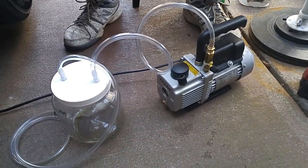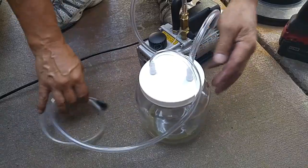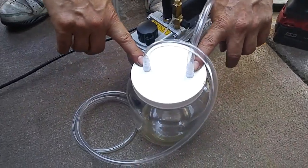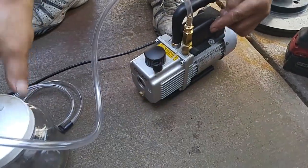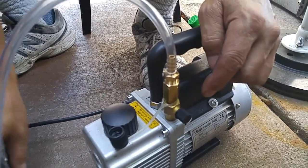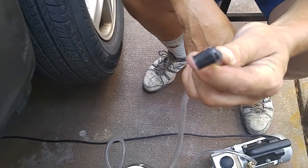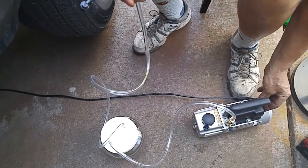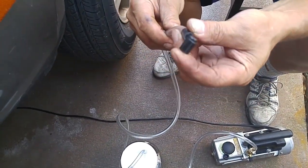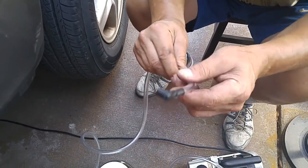We decided to use the HVAC vacuum pump. I just took a glass jar, drilled out and attached two quarter-inch barbs, bought a coupler and a brass barb attachment for the compressor, got the plastic tubing — this came from another bleed kit — so when I turn the compressor on it pulls vacuum. This is so convenient.